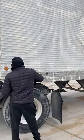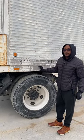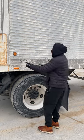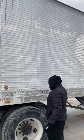On the trailer side, I want to make sure that I have 50% DOT reflective tape. As we can see, this one doesn't have 50% DOT reflective tape. I want to make sure that the trailer is not bent, broken, or cracked, properly mounted, secured, no holes. All the rivets are in place.